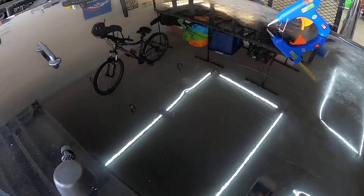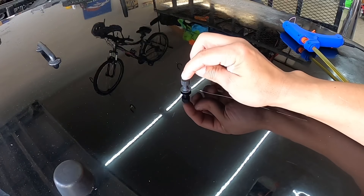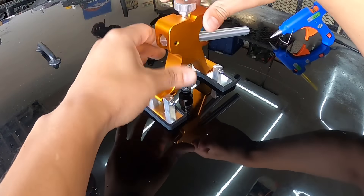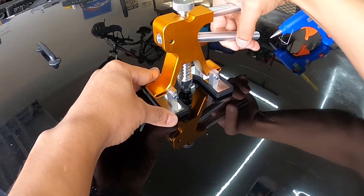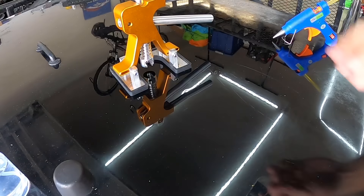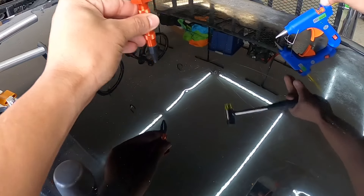We need to get out just a little bit more, so we're going to use our smaller tab and just a little bit of glue — don't need much. Let that cool off for about a minute, slide that in, and pull it back up a little bit. It looks a little high, so we're going to try to knock it down with the knockdown pin — the one with the little round point — and just go around the area to knock it back flat.